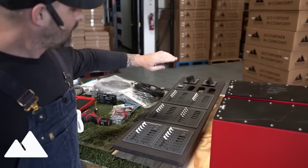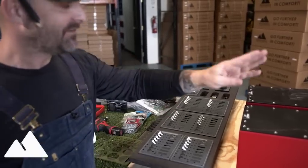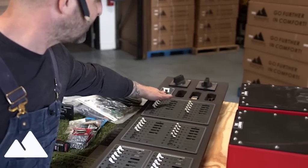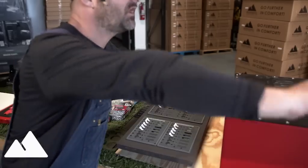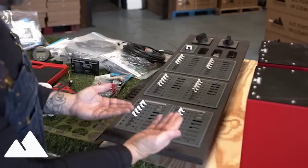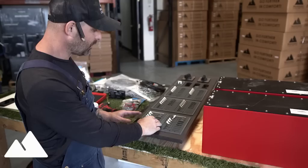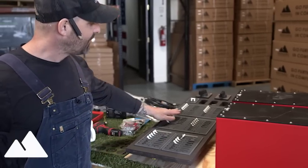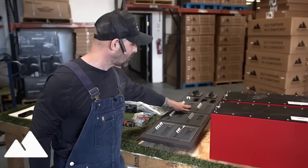Starting at the top, we have on/off switches for the 110 system, and it can go from generator to shore power, which feeds into your inverter and back. We have 30-amp in-breakers — a series of four; these are back-ordered so they're not in yet. These all go in before reaching the inverter. Once you hit that power, it'll come to 110 out. There'll be a main breaker — two different systems for the two separate inverters. Inverter one and inverter two feed the 110 outlets: a combination of 12 total, six for one side and six for the other. On the 12-volt side we have a total of 8 positions, 16 across each battery protect. This is a very complex, over-the-top electrical system.